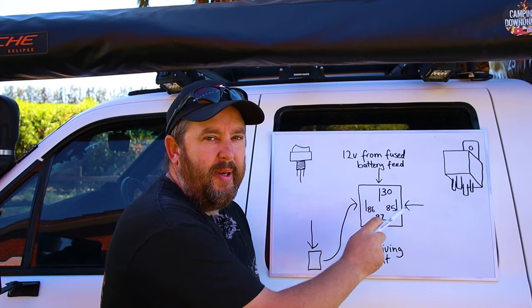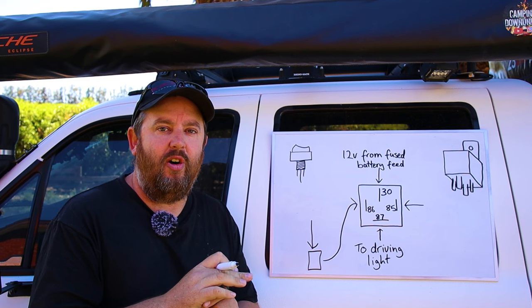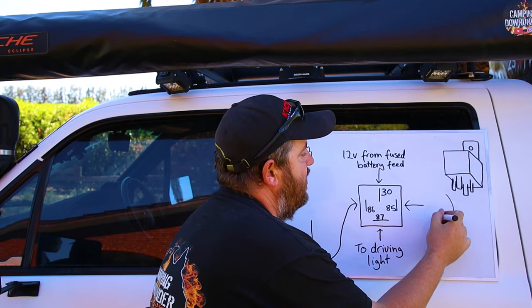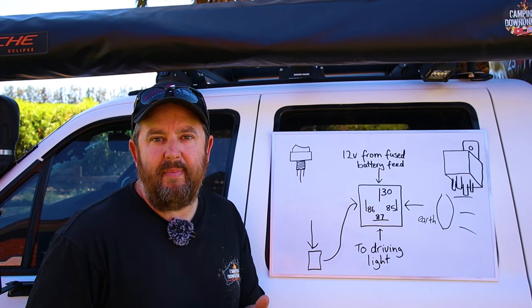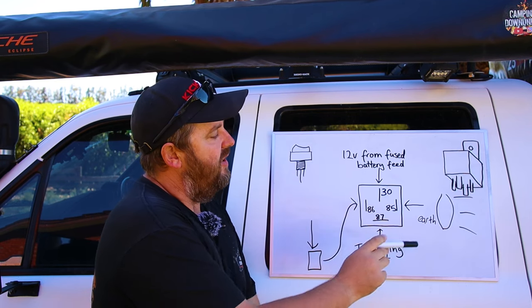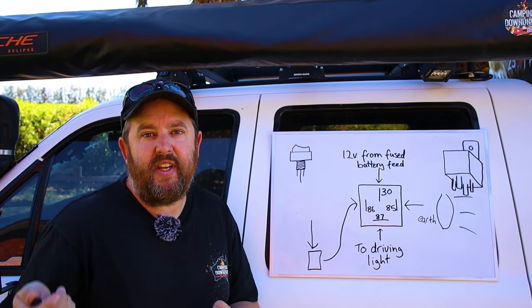So let's work out how to do negative switching. This time, rather than finding an earth for pin 85, what we're going to do is hook that earth wire onto the wire on the headlight which actually turns into a negative when it goes to high beam. So it'll be a positive on low beam and then turn into a negative on high beam — so that'll go straight to your headlight. The trouble with negative switching is that because it's an earth on high beam and a positive on low beam, when you shut the car off it'll often turn back to an earth again — which would open up that switch and let power run back through, turning your lights on when the car is off.